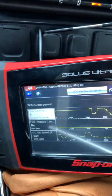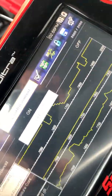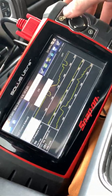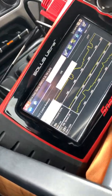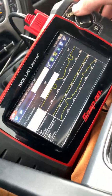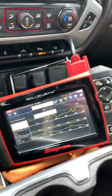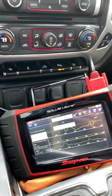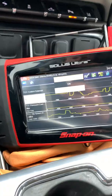I guess that's all I really know right now. Let's toggle the converter clutch on under wide open throttle during a pull in a gear, and I'm going to see if you can feel this converter lock up at 5,000 or 6,000 RPM. I can go a little over 6,000 before hitting the rev limiter, so maybe try it at 4,000 or 5,000. Let's see if it pulls any harder when the clutch comes on. If it does, then I need to do some tuning to use the clutch under wide open throttle for better acceleration.